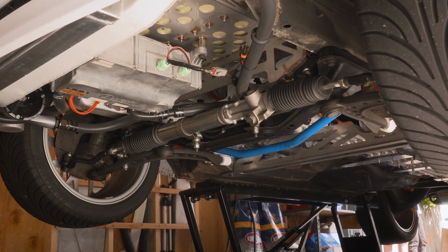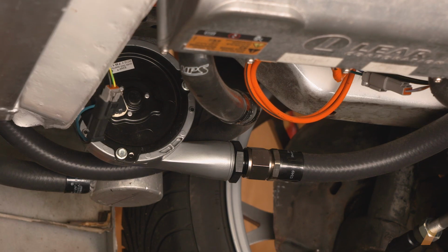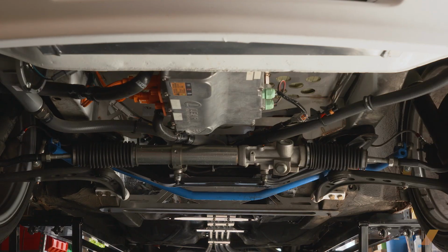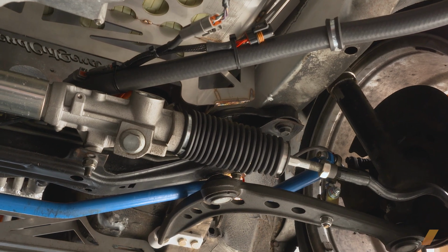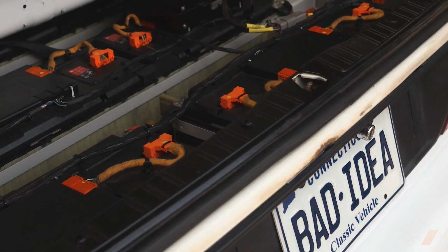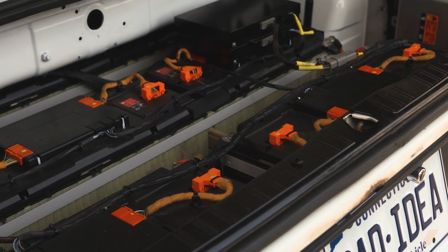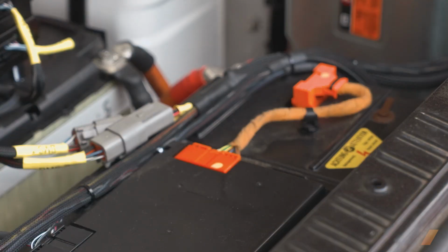One of the things that I went into with this build was knowing how fast that battery tech is evolving. These batteries are the hot ticket today. 2 years from now, that's probably not going to be the case, so I made all the battery mounts to be essentially bolt-in. In the front, it bolts to the factory radiator support and factory motor mount pads. In the back, basically a mounting plate that's laid up into the entire space of the trunk. Should I come across a higher performance battery, something lighter, something better suited to the tech improvements, then it's just a simple matter of swapping it out.